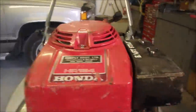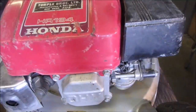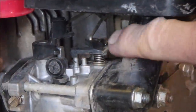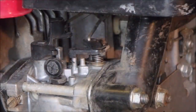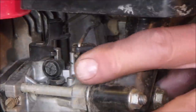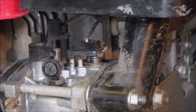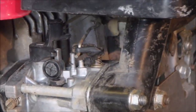I just want to get you guys focused in on the choke. The choke lever is this little guy here, this is the throttle, and that's the choke. So you should actually see them both moving, but the one on the right is the choke. There I think it's closed, and there it's open. So it actually should start in either position and it won't. It's been sitting all night. I did go out to the shed and change out the pull rope — you can see that there. It had no spring in it or rope, but I just happened to have one.